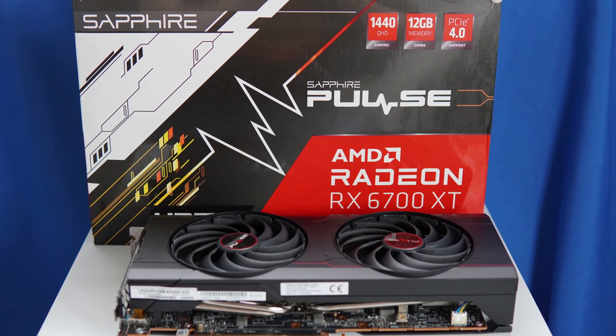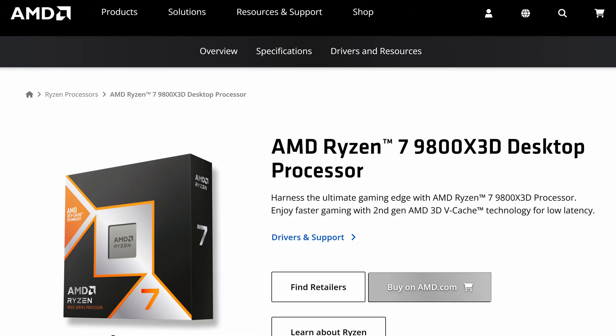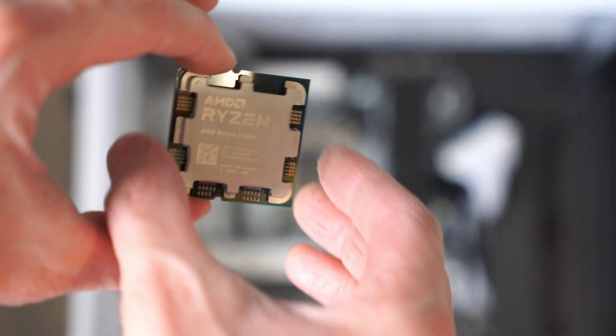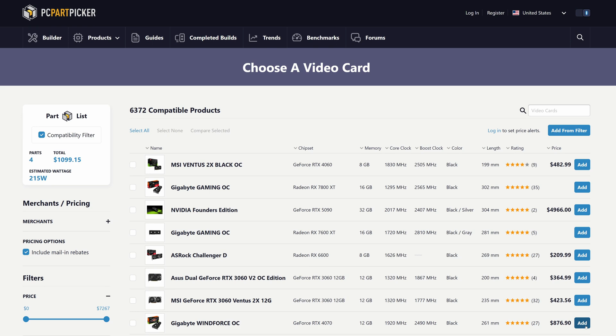Both of those options are fairly good, but let me talk through them. The first option is keeping your PSU, and that can work if there's not that much of a difference between the minimum requirements for the card and what your PSU is. For example, they might be assuming you've got a 120 watt CPU, overclocking, and loads of fans using two or three watts each. But if you just have a more mid-tier CPU, you might not be going anywhere near that 650 watt power usage level, in which case your new graphics card will work absolutely fine with your 600 watt PSU. PC Part Picker is quite good for giving you some level of estimation on that.